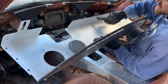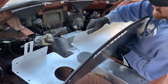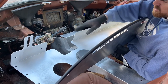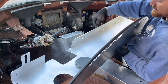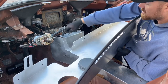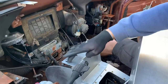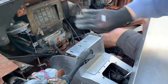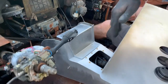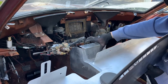These slotted holes here, you can put an R clamp in there too. We don't include the R clamps, but we wanted to put the holes in there so that you had an easy spot to mount. But these slotted holes line up with these holes in this plate. So once we get it set into position, you can bolt it. Obviously there's adjustment forward, back, and on this, you have adjustment left to right. So you have quite a bit of adjustment to get it mounted to this plate.